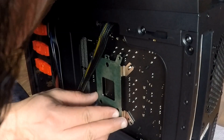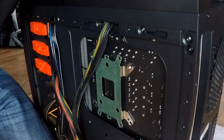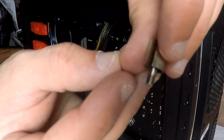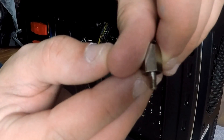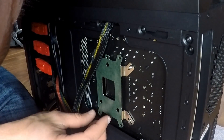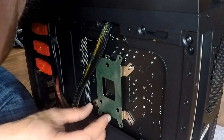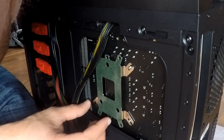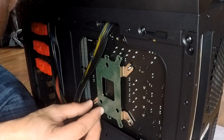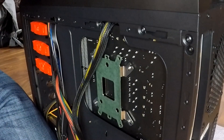Put the bracket first before putting in the screws because you're going to run into the same problem otherwise. The screws need to be oriented a certain way — if you look real close, there's a little flat notch and that's what slides right in. You've got to rotate the screw until it falls into the notch. From here we're going to put in the nuts.